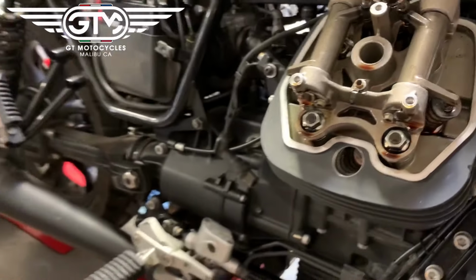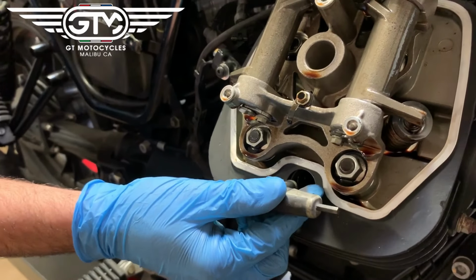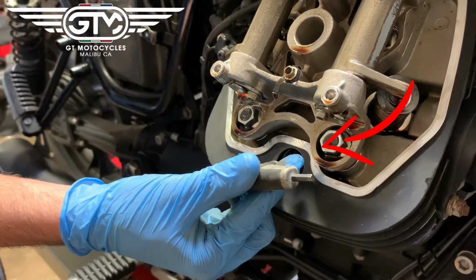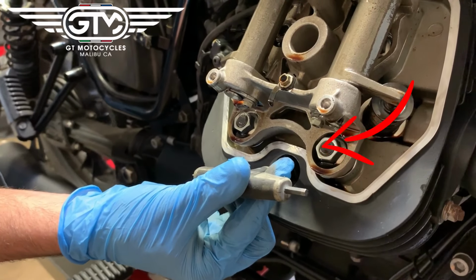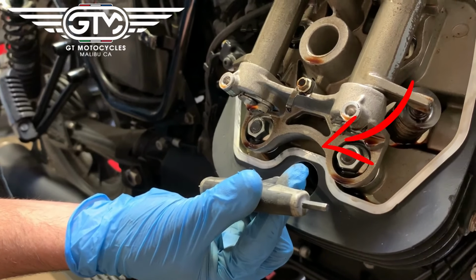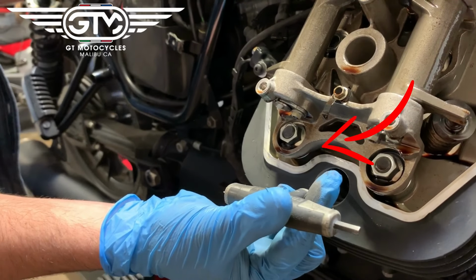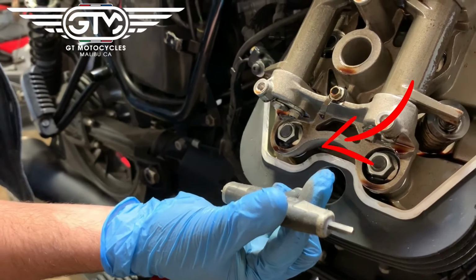So then from there, people use a straw if you know what you're doing, and don't let it bind on the piston. You can just use anything like a screwdriver, and I don't know if you can see that, but we're bringing it up to top dead center. If it drops even a tiny bit, you've gone too far. So you want this thing about as close to the very, very top as you can. You see it climbing? Still climbing, and we should start to see it drop any minute. Dropped, and then back up just a little bit. Good.